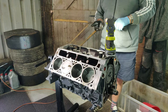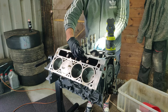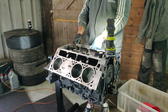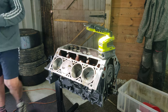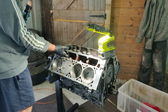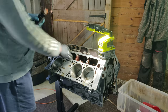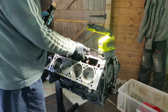The next step is a fairly simple one — installing new lifters, using brand new LS7 lifters from GM. These are hydraulic lifters filled with oil. One end has a roller on it which sits on the cam lobes; the other end pushes up on the pushrod, which in turn actuates the rocker arm and opens the valves. Very old school and very simple, but it just works, and they're very important — hence replacing them with brand new items.